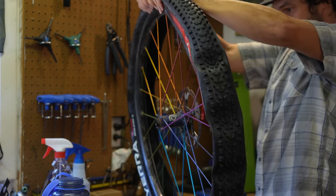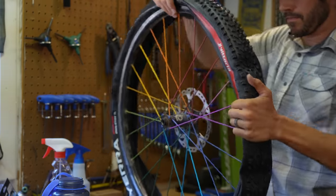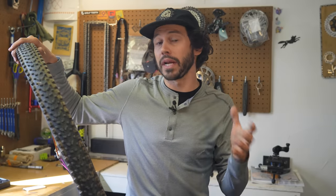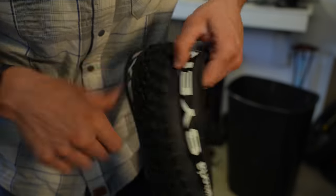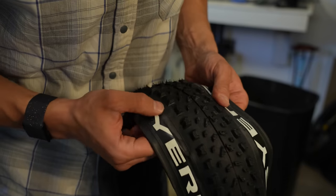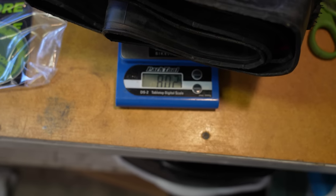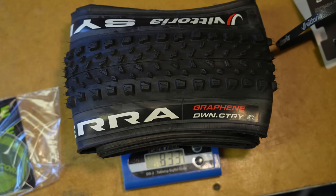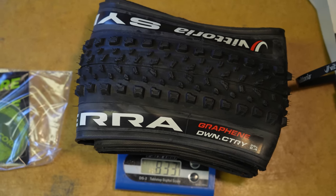This channel is also intended to help shed debris and light mud. For installation, I used the Sierra tires with XC CushCore tire inserts — I have more thoughts on those but need more time, so stay tuned for a future video. Feeling the tires out of the packaging, they felt inconsistent — some parts of the sidewall felt really thin. I weighed them before mounting and they came out to 802 grams and 833 grams, which may have contributed to that inconsistency.